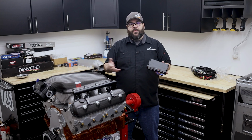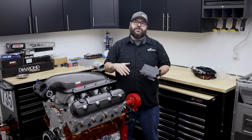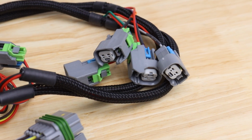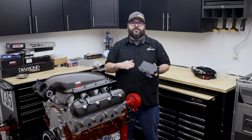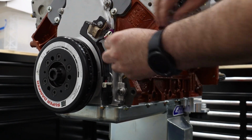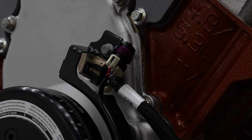The kit is available with a 3.5-inch touchscreen controller, which is a nice touch when this goes into a car, but for now, we'll be taking full advantage of the powerful Windows-based software at the dyno. The included harness is plug and play with the specific LS engine it's designed around, meaning there's no splicing or special sensors needed to unlock the full potential of the ECU. Just connect the harness to the factory sensors and bam, you have a fully controllable standalone ECU setup.